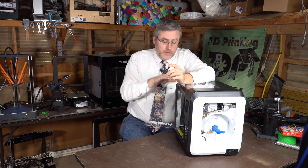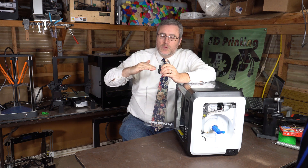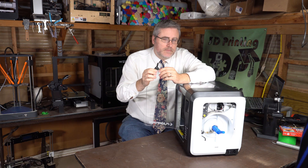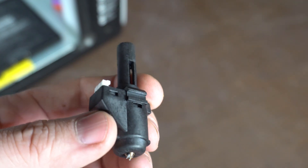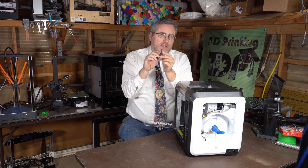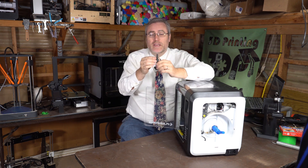However, the nozzles that came with most of these 3D printers had a problem: if you printed too hot with PLA, it would cause serious overheating, sticking inside, and print failures. You'd have to lower the temperature just right. I think the problem is that this nozzle has no cooling fins — just a big tube that blows air through. If they had engineered it with cooling fins like we're used to seeing, those little metal fingers that grab more surface area, that might not have been an issue.